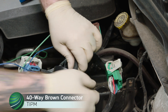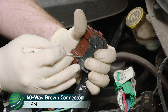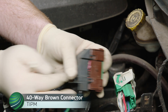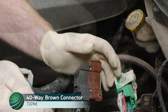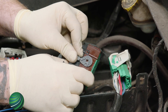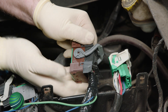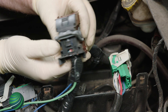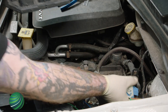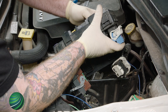Tape the wiring harness and protective sheath, then reinstall the connector protective covers. Reinstall the connector locking lever by sliding it over the connector and engaging it onto the pivots. Then reinstall the TIPM connectors and install the TIPM module in reverse order of removal.